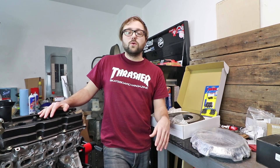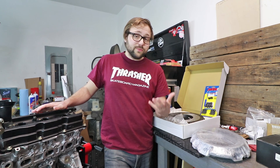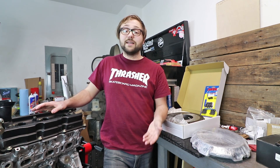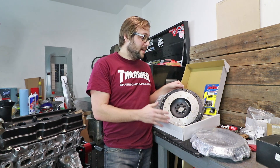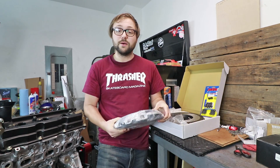I also want to talk about some of the stuff going on at the rear of the crankshaft in the form of the flywheel and clutch setup. One of the things I was considering was the overall chassis this was going into — the Datsun is actually really light and this engine produces enough torque to push it along, so I wanted something that would liven up the engine rather than bog it down, and ultimately that meant a lighter flywheel. A lighter flywheel will spool a lot quicker and help liven the engine up, letting it rev a lot faster, which I think is a really good combination with the larger camshafts I have. I found exactly that in this aluminum flywheel from Jim Wolf Technology — a 14-pound all-aluminum flywheel — and along with that I also went with a much beefier clutch setup to help grip up and get the power down to the wheels.